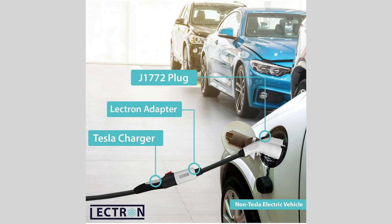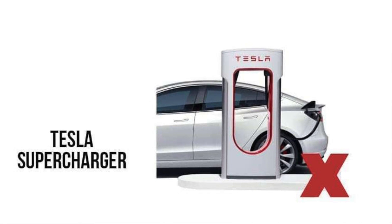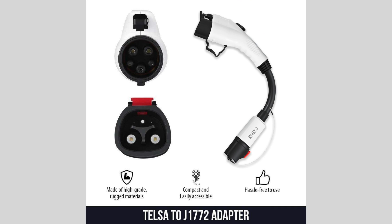Now this doesn't work on a couple things. It doesn't work on Tesla Superchargers, and it doesn't work on the higher amperage wall chargers that are like 80 amps on vehicles that can't accept the higher amperages. I just bought a Nissan Leaf, a 2012, for my son, and apparently I had to dial down the wall adapter from 80 amps to 40 amps in order for this to work.